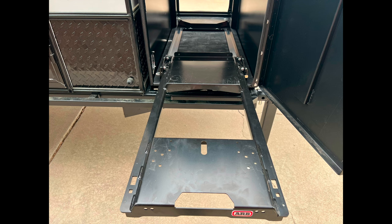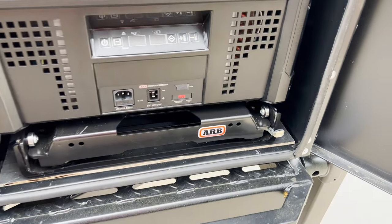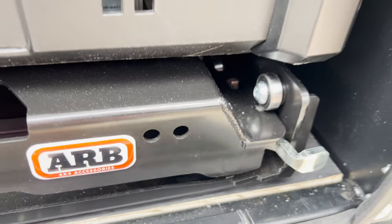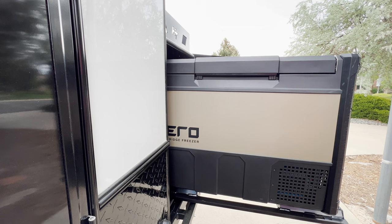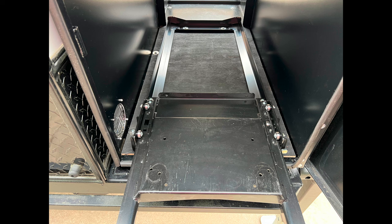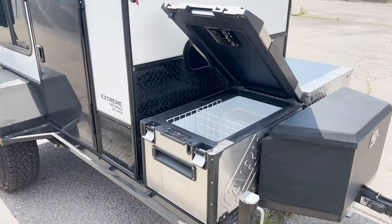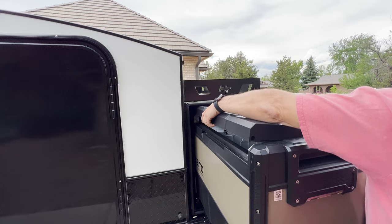The next morning I opened the fridge box to start thinking about how I would begin prepping it. I extended the slide to see what the inside space would look like and right off the bat started to get a sinking feeling. When I extended the slide, I couldn't help but notice that the bed of the slide did not completely extend out of the box — in fact, not even close. A full 25% of the slide bed was still inside the box even when fully extended. I placed the fridge back onto the slide bed and became even more concerned when I realized the fridge was meant to sit back on the bed rather than flush with the front, meaning it would not clear the fridge box enough for me to open the lid. I called ARB support and they confirmed everything was as it was supposed to be. ARB explained that the slide bed was kept back on purpose to create stability when holding heavy appliances. In ARB's defense, if my fridge had opened from front to back the way many fridges do — including my Elements fridge — this probably would have worked. My ARB Zero, however, opens sideways and does not clear the box.